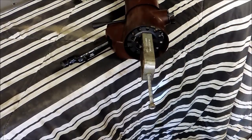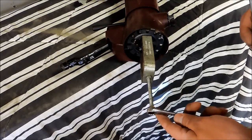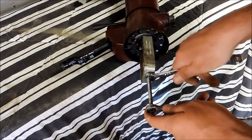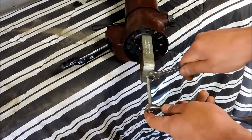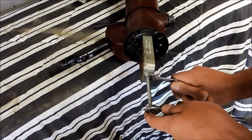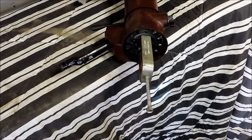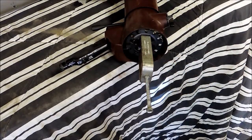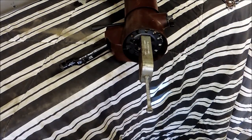We've already seen the lock plate in here and that's got to be removed. Take your little steering wheel lock plate remover, stick it on there, and tighten down the bolt on the bottom. What that does is press down the lock plate so you can get at the retaining ring. Don't press it too far down — it is relatively easy to bend it, which can cause interference issues. Then pull the retaining ring off. It can be a real pain; I think it's probably half the problem in the whole deal. Once you get that done, slowly release the steering wheel lock plate depressor and we'll be ready for the next step.